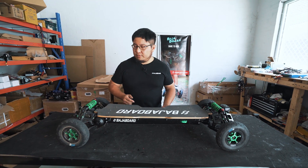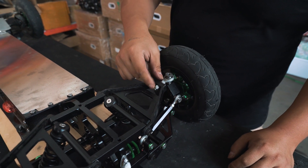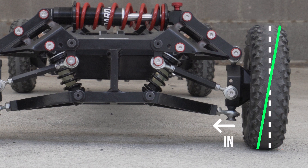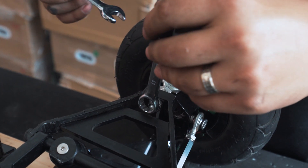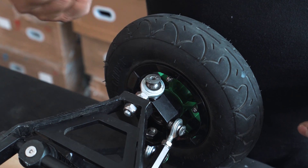The best way to adjust the camber is to just turn the board upside down first. You can adjust the actual position of the rod end with these two nuts. If you elongate this, the bottom of the wheel is going to lean out more, giving you more of a negative camber. If you take this in, it's going to lean in and give you more of a positive camber. To adjust the camber, you basically need two 13mm spanners — definitely one with a ring spanner — and you're just shifting the nuts in and out to move the relative position of the rod end to affect the camber of the wheel.